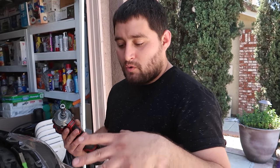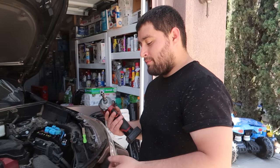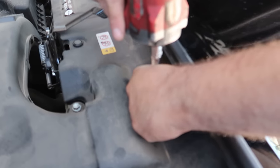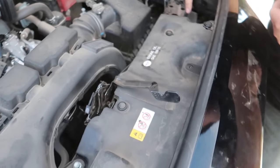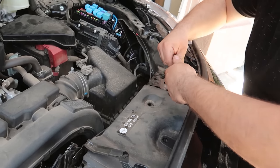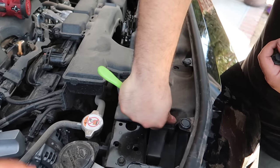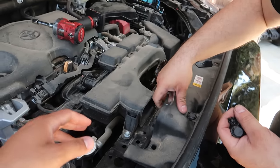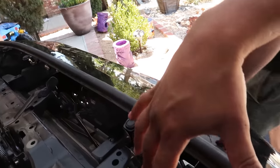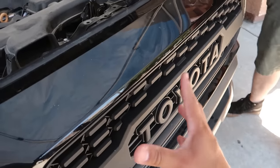To make this as easy an install as possible without removing the bumper, the way we can access the back of the grille to run the wires and the Raptor lights is to take this cover off. There are two 10 millimeter bolts — one right there, one right there — and then we're also removing the clips that hold this cover on. Go in with the panel removal tool and just like that, super easy. By removing those two bolts and the clips it takes this little cover off, giving us a lot more room in the back to access the space, zip tie the wires, and install the Raptor lights onto the TRD Pro grille.